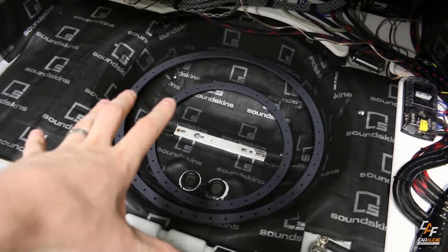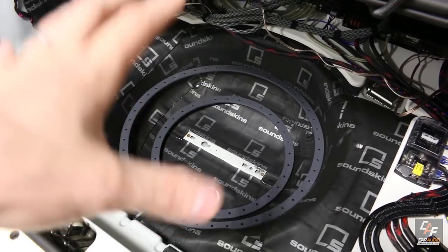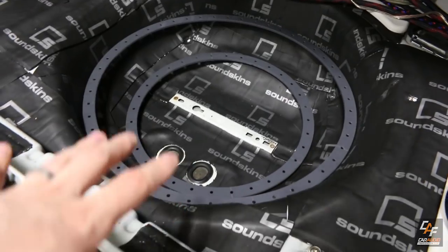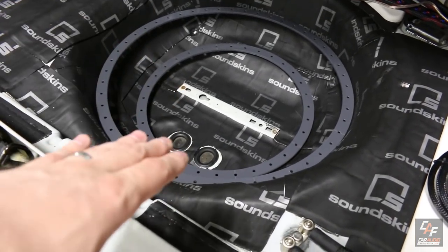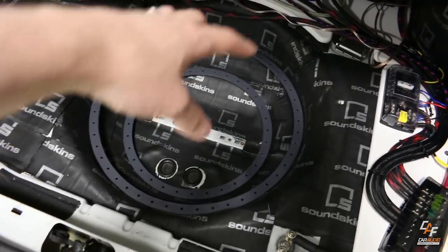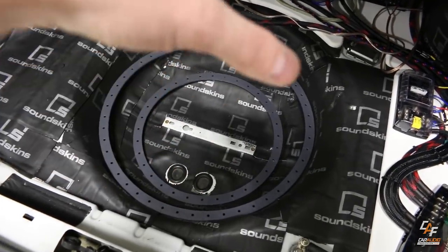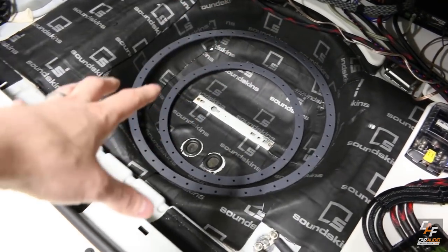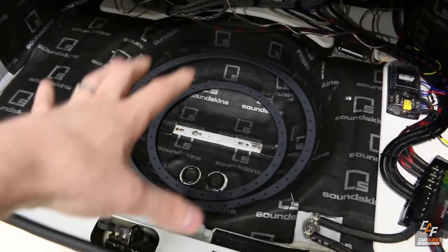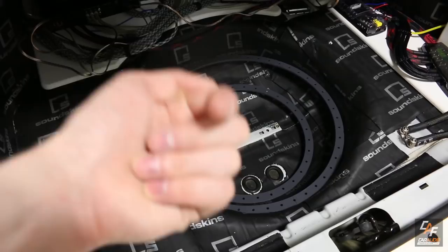Now it's a matter of working through the math here in the trunk and thinking through my process. I'm going to use two different circles in order to stack a profile that will become the box. Because I'm using these two different circles I can easily measure the inside diameter, use that to determine the air volume, and calculate the volume of this enclosure. I'm going to do some pencil and paper math and come back with the findings.